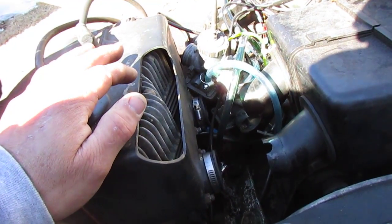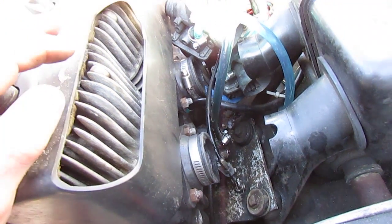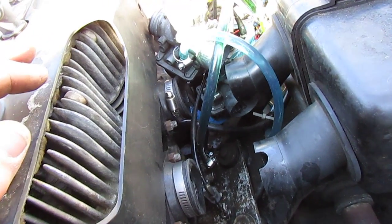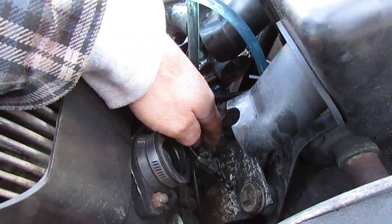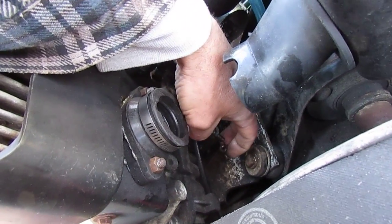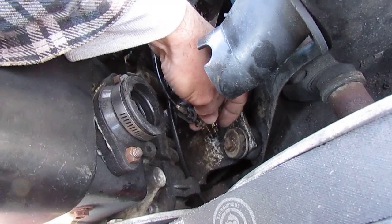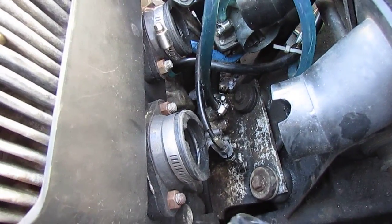I'm going to do another video where I take the injector pump off and show how I put new check valves on it — what to look for and what not to. I'll also do a video on how to adjust the connection here because mine's loose — the nut came off the bottom. Once I get it set right I'll Loctite it in place so it doesn't budge. That's some of the pros and cons of oil injection — let's get on to the next video.